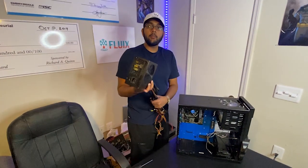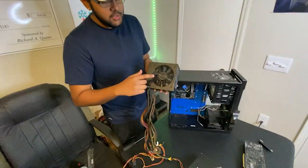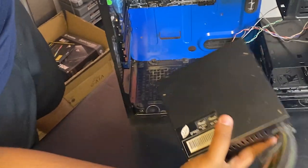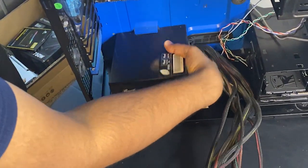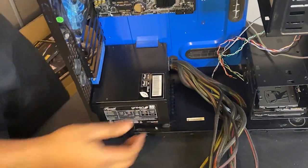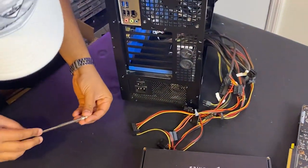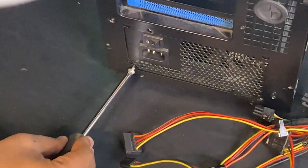The next thing we're going to do is plug in our power supply. The first thing you'll notice is the power supply has a fan — you want to make sure the fan corresponds with the bottom vent hole right here to allow air to pass through. Place the fan down, route it in to the back, and fit it in. Ours has a little loop that locks it in. Get it under right here in this particular case, then move it down to the back and screw in the power supply.